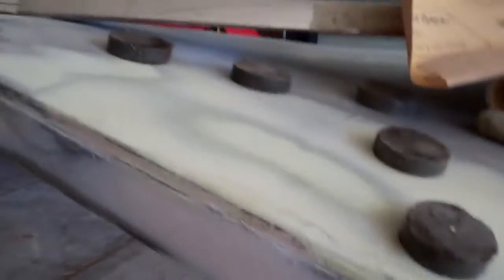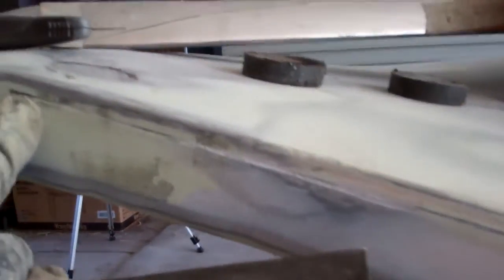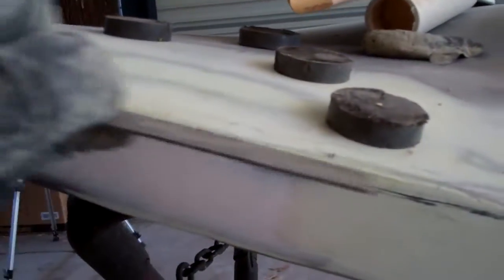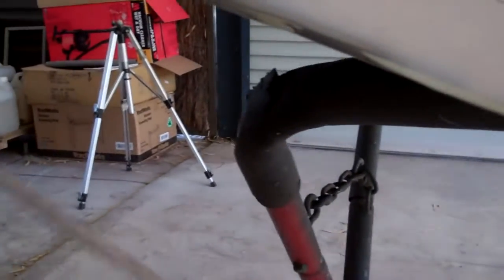What I'm trying to put in here now are these grooves just on the ends of these wings, which were there to start with. I'm just trying to knock out the body filler and make a line in there. I've just run a Stanley knife across a steel ruler to give myself a track or a line, and now I'm just slowly going along with the edge of the steel ruler and gouging out a line. Then I'll use some 80 grit wrapped around that and file in between the groove to get a nice little channel.